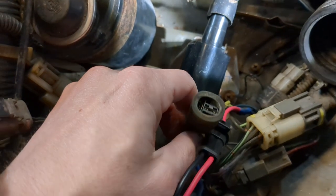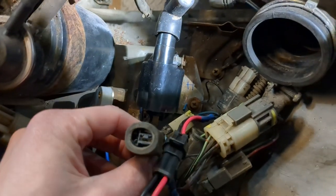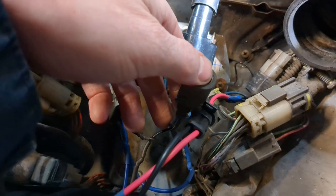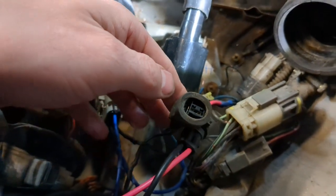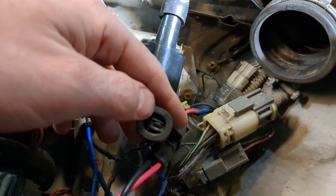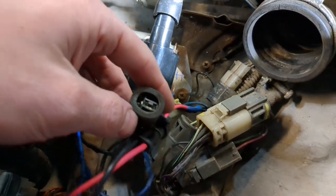And if your colors don't seem like they match up quite right, here's an easier way to reference that. The driver, the one that's coming from the left side of that igniter, is coming from the top of the T here. The constant is the leg of the T.